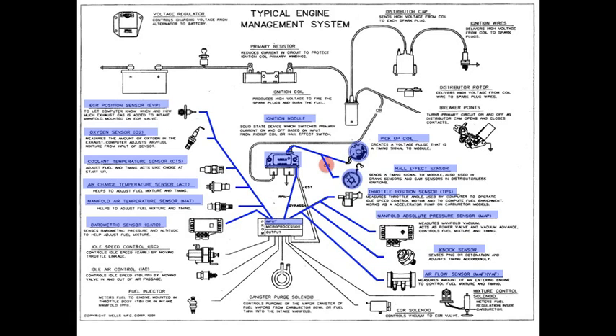All of these inputs are signals that come into the PCM so that the PCM has data it can use to calculate — and what does it calculate for? So that it can control the outputs. We have an idle speed control, and sometimes there are a couple of variations to that. We also have outputs that are fuel injectors, which have to be told when to squirt fuel. We have a canister purge valve that has to be told when to operate, an EGR solenoid that has to be instructed, and a fuel mixture solenoid. All of these are outputs — things that the computer is trying to control.